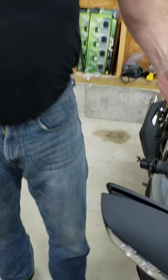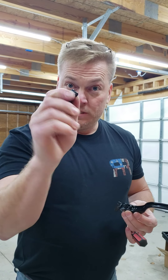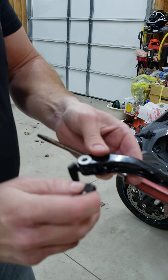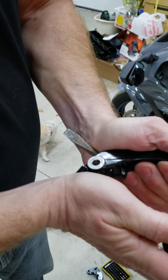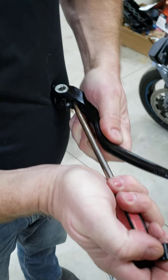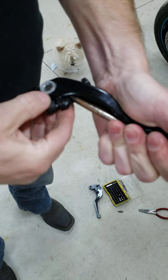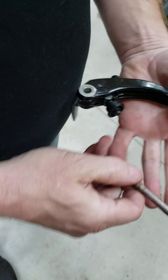Throw the Chinese one away and I'll be right back with the factory unit. I learned a lesson trying to pull this out: the turnbuckle — the little lock-in-place tab — won't fit into the factory unit. Flex it out as much as you want and try to slide it in, but it doesn't work. The way I found is you flex it just a little bit, stick a screwdriver in here, a little bit of pressure, and she'll drop right back in. No worries — just like that.